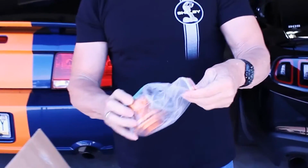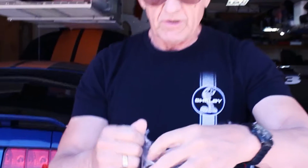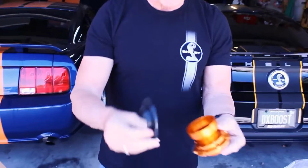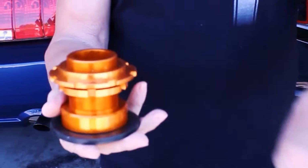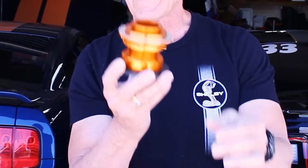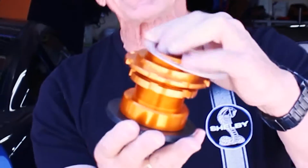And then we have the spring pads with the shim, and it's metal, it's not plastic, so it won't crack, with a little rubber bumper for the spring pad. Fully adjustable to help the ride height and, I guess, do the preload on the rear spring. So when I do the installation, which will be in an entirely separate video, I'll make sure that you understand how that preload takes place on the rear spring when we put these pads in place. And of course there's two of these. There better be. Yep, here we are. And there's two of those.